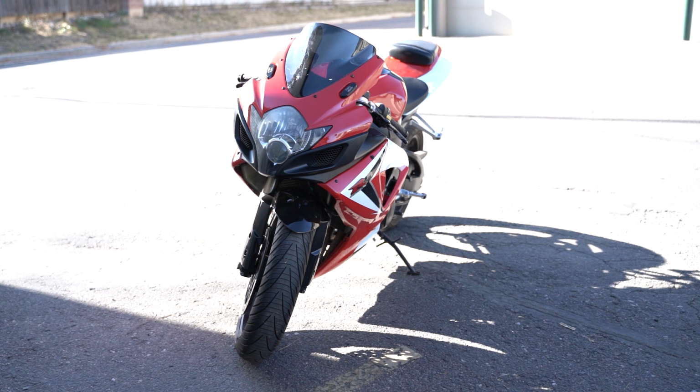I bought the little emblems for the side, because aftermarket fairings usually don't come with the emblems. And then I fixed the master cylinder. There was an issue with that: the piston in the master was freezing up, which wasn't allowing me to brake properly, because on the Gixxers you have 2 brake lines that go to the right side caliper, and then 1 line from that side to the left. It was basically seizing about halfway through and then releasing, but eventually it just seized completely.